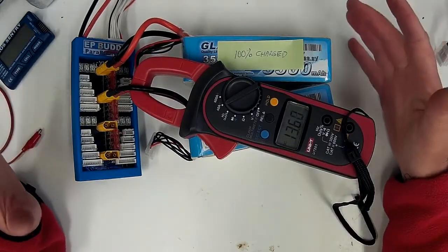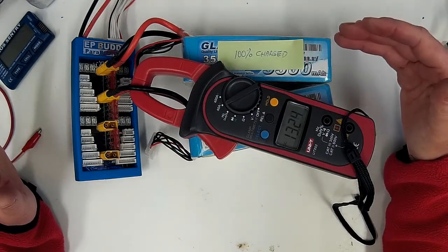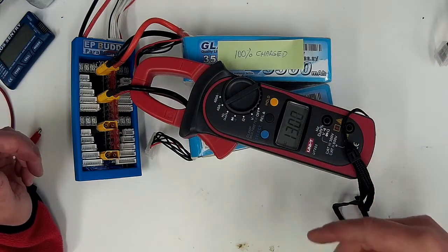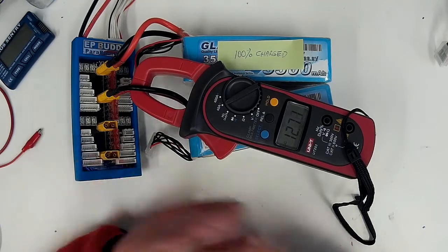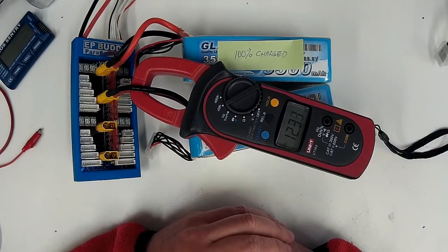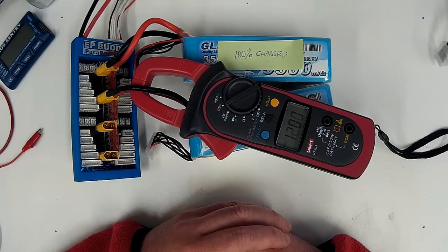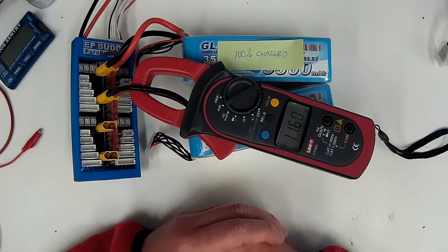The current flowing from the fully charged pack is not usually the issue, because LiPos can flow a lot of current. It's the input current going into the discharged pack — that's what you have to be careful about. I just wanted to do that little demonstration because I was getting questions on current flow between packs and what is considered safe and how do you check it — this is how you do it. Stay within that 0.1 volt difference between cells and you should be good. Thanks for watching, folks.